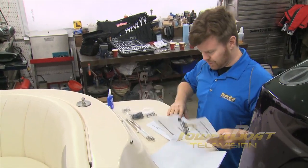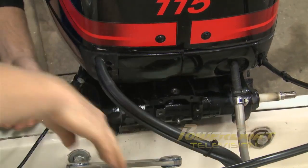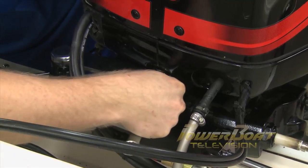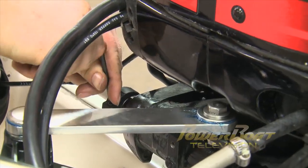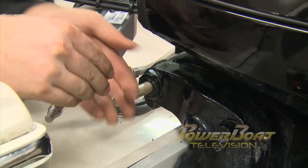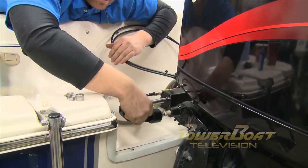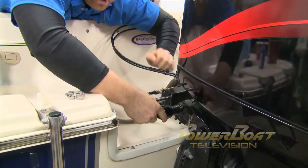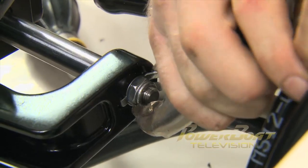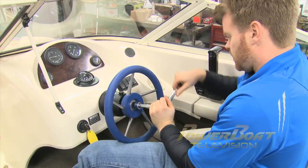It was then time to mount the hydraulic cylinder. I first installed the 2-piece tilt arm. I then affixed the cylinder to the engine, first by attaching the link arm. I then installed the collar over the old mechanical connection on the starboard side and the provided spacers on the port side. I was then able to install each of the 90-degree connectors, making sure to use Loctite. With the connections finger tight, I then snugged them completely down, along with securing the lock washers. Finally, all I had left to do was secure the wheel.